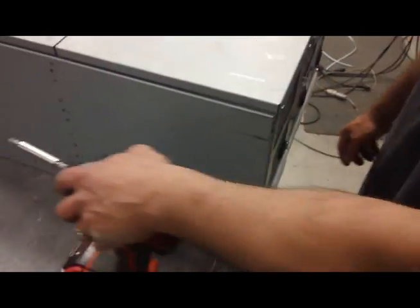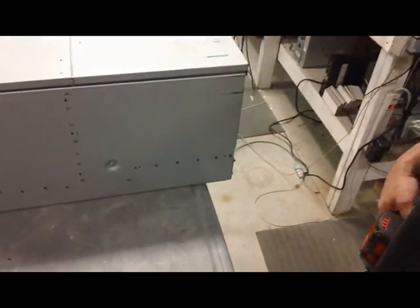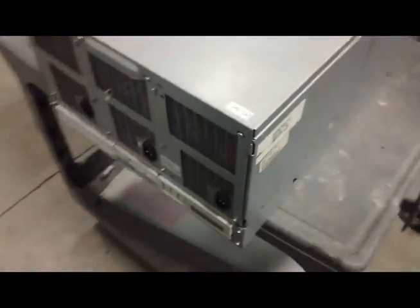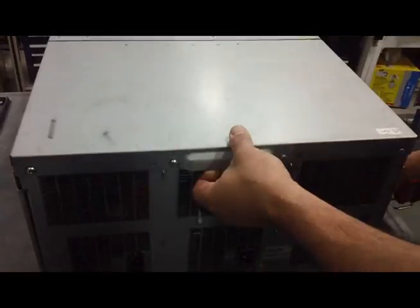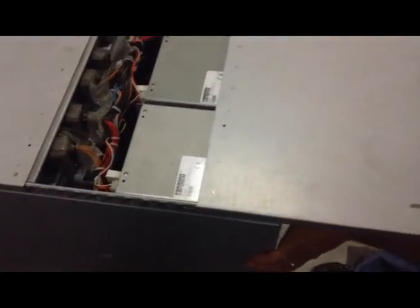All right, so we got the server up in the cart, took it out of the cab. You could probably do this procedure while in the cab since the tray pulls out far enough, but we're doing this for ease. There are basically two screws on each side that hold the power tray. Take those out, then there are two screws right here that have to come out — don't touch these yet. That moves the front tray so it slides right out. There are two tracks, so it just pulls straight out.